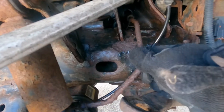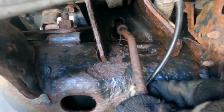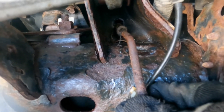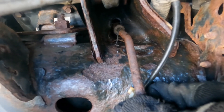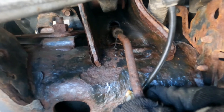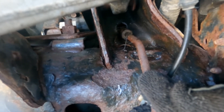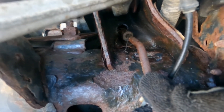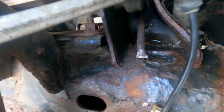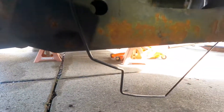There's a union fitting for the brake line that goes in between the plate, with a C-clip on both sides to stabilize it. The fitting goes on the opposite side — very awkward to reach from the bottom of the car. I removed both C-clips and I'm going to cut the line so I can pull it through to the other side to get to the fitting. We chiseled through the line — quickest and easiest — and pushed it through to the other side.